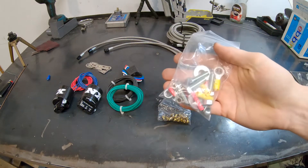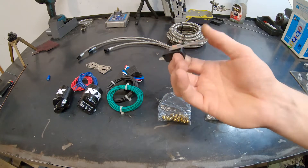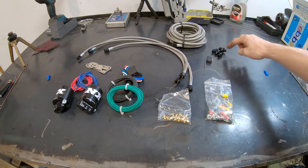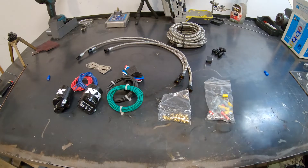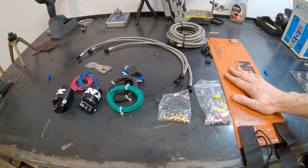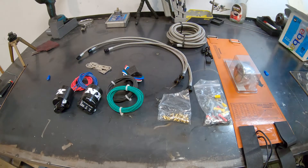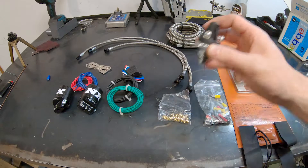I've been using my own bolts because I like the cap head style screw. A microswitch so you can tell when the engine is at full throttle. You need some ways of connecting those lines up, which happen to be dash fittings - they're all dash four except dash six for that one. And this is recommended but not essential: a blanket to heat up your bottle. If you don't have this, you don't run the correct pressures a lot of the time. You'll also probably need a gauge - this is a Nitrous Express gauge. It's kind of important to have, they're pretty cheap, definitely get one. With your blanket you'll get a Hobbs switch or pressure switch, so it tells the blanket when to turn on and off.